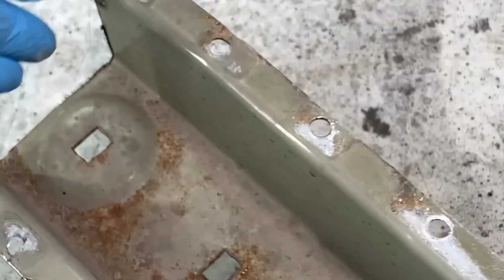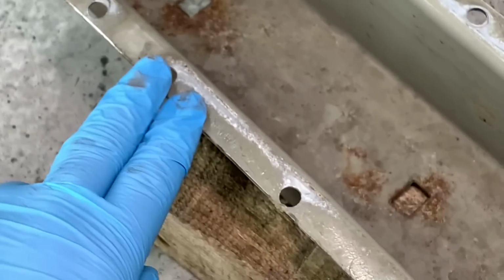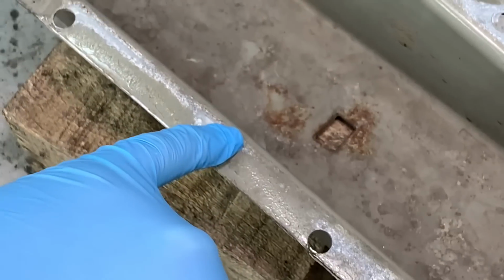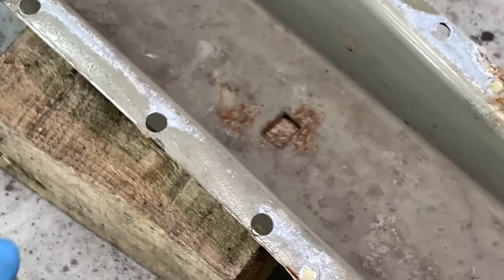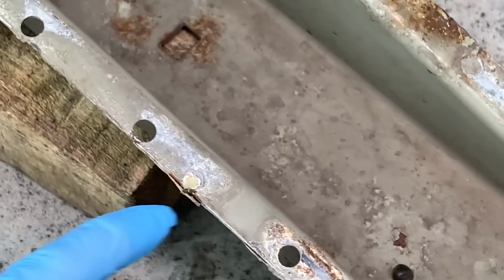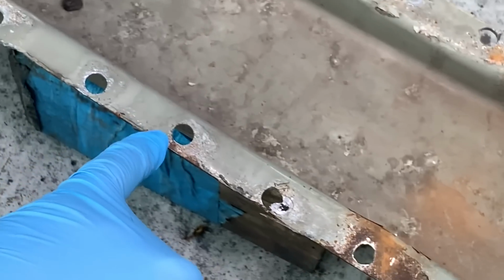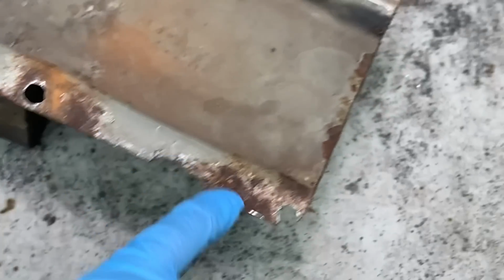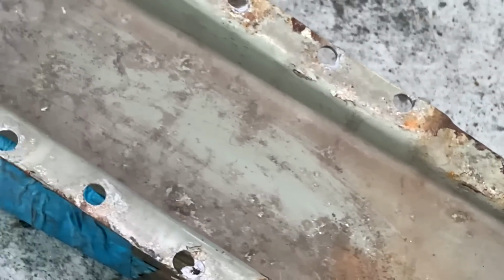Now we're going to study the cut line on the inside with a camera to make sure there's nothing further in. And most of these contact patches are nice. This area here, these white bits, are bare metal. That's where the E-coat hasn't got in there when it was dipped in the multi-stage E-coat bath at the body in white stage at the factory. But amazingly, they haven't corroded, but on this one it has, and some of these edges it has, and a lot more apparent near the end of it. No cavity wax at all, completely bone dry, just dust in there. So no wonder they rust. I mean, why the factory don't put a good amount of cavity wax in there, I don't know.